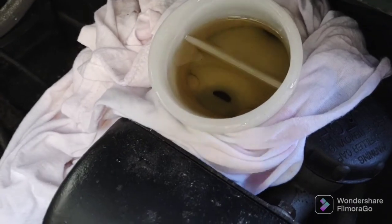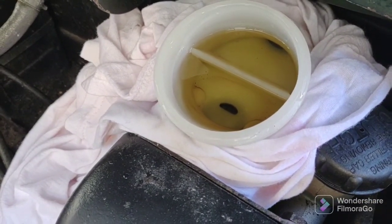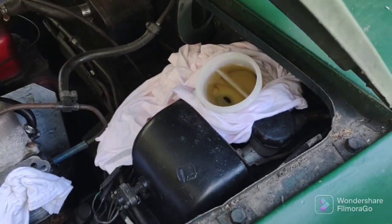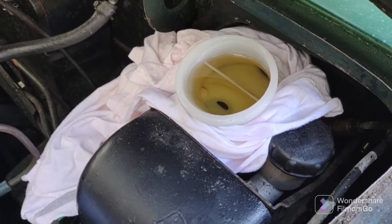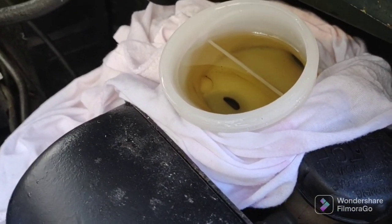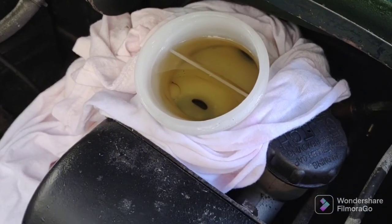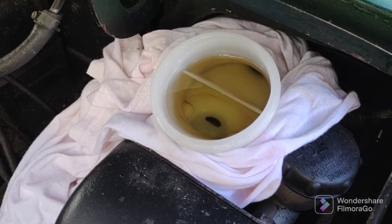So once again, the front reservoir is emptying pretty rapidly. If you don't want to have stress, open the bleeder a little bit. It'll take more time, but you don't have to panic that your reservoir is going to empty too fast. So the front ones were a lot quicker. The nearest to the master is the fastest. That makes sense. Another helpful hint, my little trick: I fill the master and then I get under the car. That buys you some time. You don't want to be up here with your master almost empty and then get under the car. Use common sense. Should your master empty while you're under the car, you'll just have to repeat the entire gravity bleeding process, starting from the right rear. There's no two ways around it.